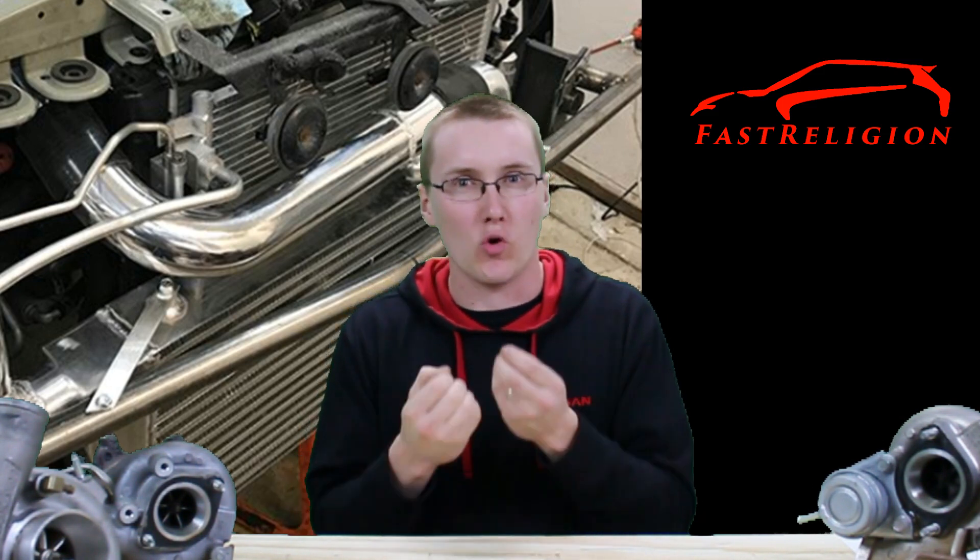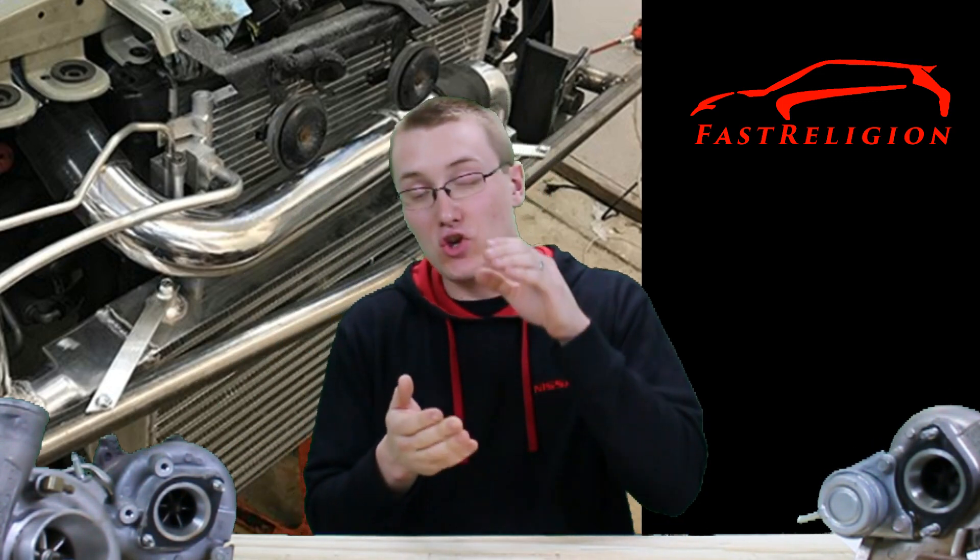A lot of you are running a factory turbo, so that's not the biggest deal — you're not making enough horsepower to generate so much heat that you'll saturate the intercooler. But consider this: if you're running your factory turbo and you have a huge intercooler, that small turbo has to fill that entire volume before it actually starts building boost pressure. That creates turbo lag — it could be a couple hundred extra RPM until you hit peak boost. Most people won't feel it on a factory turbo because it spools so quickly, but you are overworking the turbo. It now has to spin faster to create the same boost pressure it normally does. So there are intercoolers that are too big.